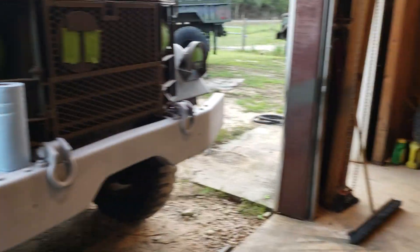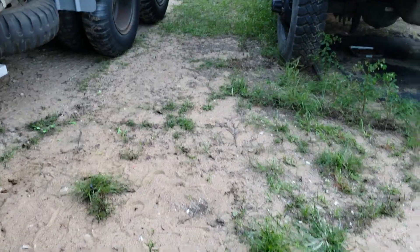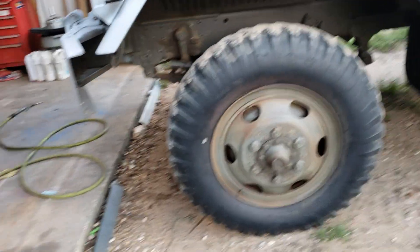Or you can just Scotch-Brite it, wash it off, and paint it. What I do is Scotch-Brite it, wipe it down with rags and xylene to get the dust off, then shoot it. I have done some where I've sandblasted entire vehicles down to bare metal, primed them, and done paint — but with sandblasting you can never get rid of the sand once it's in; it just gets tracked into the shop. I'd suggest soda blasting instead — the soda gets into the dirt and goes away, and it keeps vegetation from coming back.